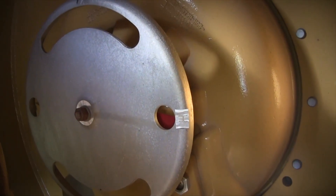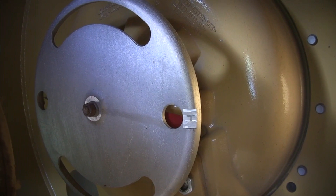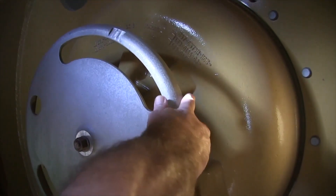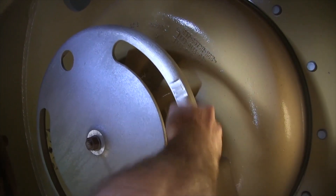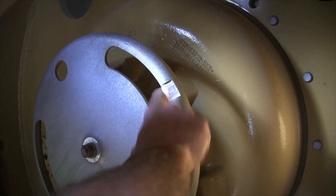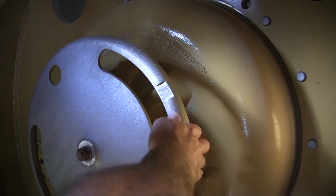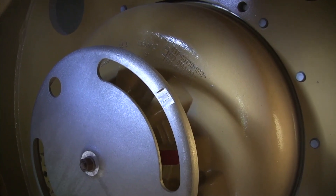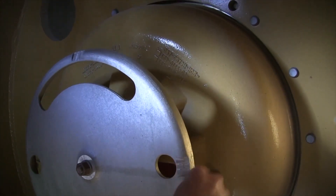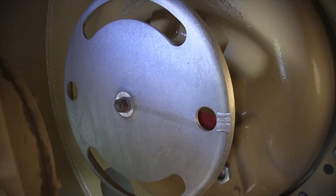You can actually see that disc is already on the high setting. The red tab there is lined up with high, meaning it's on that high setting. If I have to change that, I just reach in, pull that disc, rotate it to the low setting — you hear it lock in place? Now it's locked in the low setting. Note that the tab does not always line up perfectly with the markings on the disc itself — don't get too worried about that, you'll feel it lock in place. I'm going to pull that disc out and set it back to the high setting for this inch and a half lift. Rotate — and it's locked in place. Now you can see it's lined up on high. Front and rear drum both on high — we're ready to go.